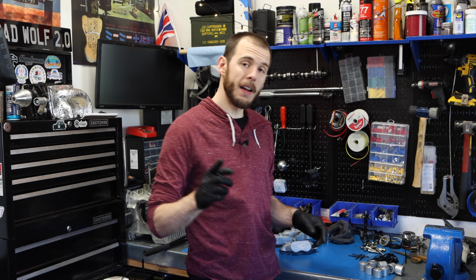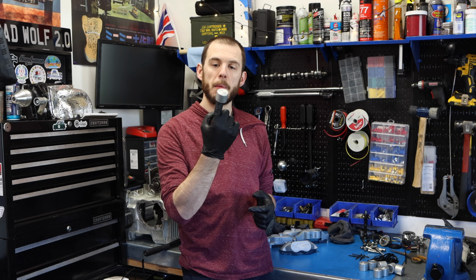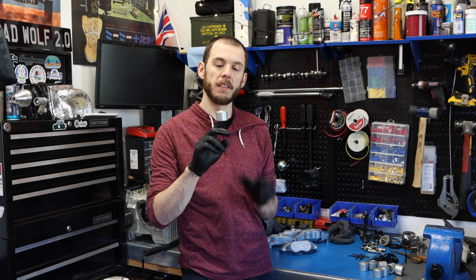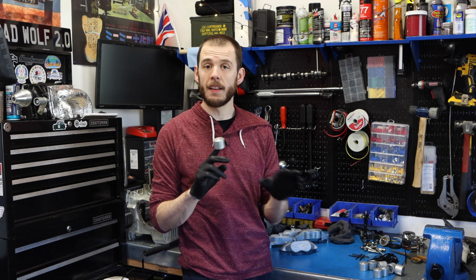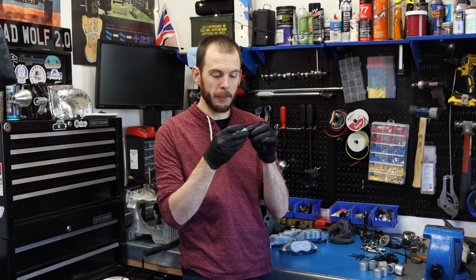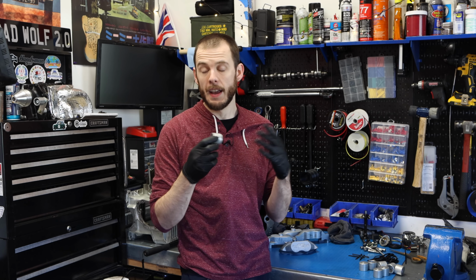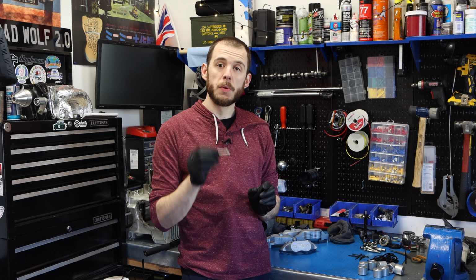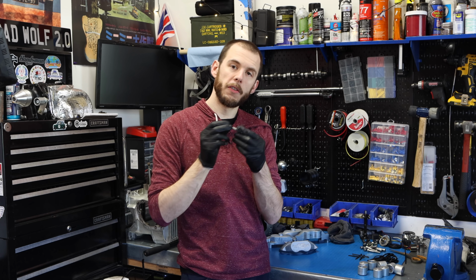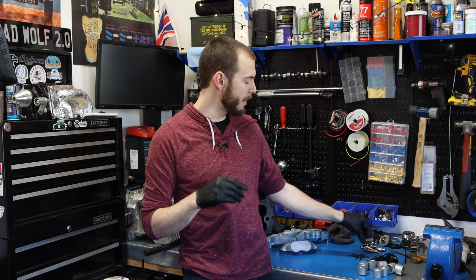One other thing you might not have seen is that the actual pistons that we pulled out of the four pot brakes were not put in the Easy Off. It's not necessary at all to put these in there and remove the anodizing. These have a silver anodized coating, and we want to keep that because that's going to protect these. And obviously these are never seen. They're inside the brakes. The other thing we didn't do are these really nice Allen key bolts. I just brake cleaned these and got all of the gunk off of them, so they're nice and clean.